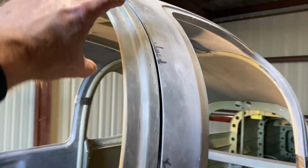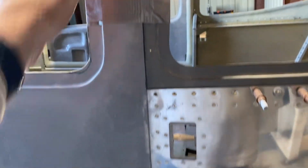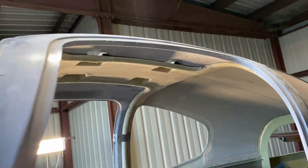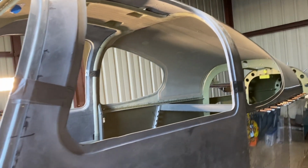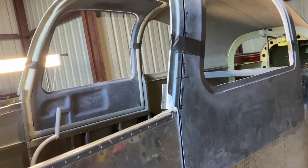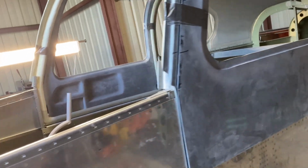And you can kind of see here already, it's already moved in quite a bit. Same in the back. Again, it's pushed out because it's not in on the bottom. I think it'll be okay, and when it's not, you can always furr it in. But pretty close. So the next thing I'll do now is put the hinges on there, get it swinging on the hinges, trim it down a bit, and I still need to fill it and then kind of smooth it out.